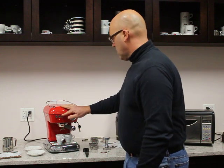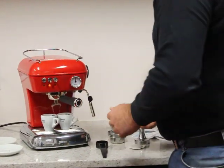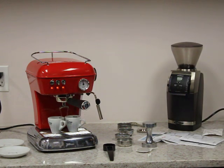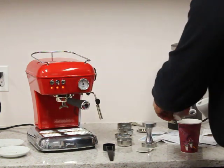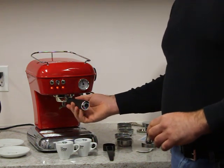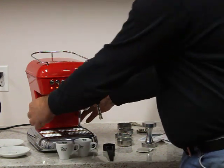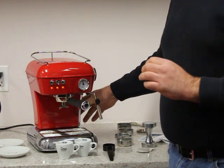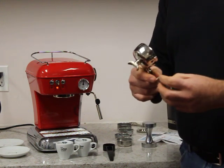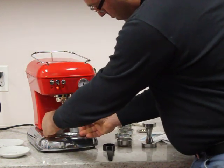Put some water through and put on the tip. The best way to preheat your cups is from the hot water of the machine. It is normal for a little dripping here to occur — there is a three-way solenoid valve that relieves the pressure of the group head, which actually reverts back to the reservoir. Previous models had a pipe right here; the new Dream Up Version 2 does not have that pipe. We can insert our pod — there is a little flap — insert the pod into the basket. This fits nice and easy, and we'll make our first shot of espresso.